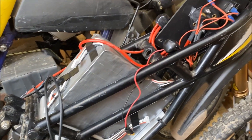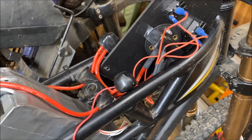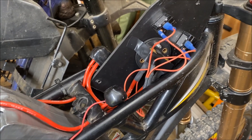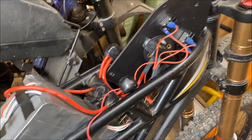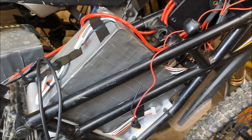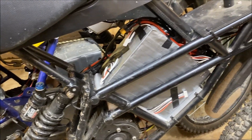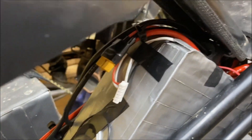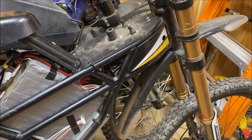While installing this battery pack, I'm adding my control panel — a pre-charge resistor and a large marine switch to turn it on and off. It was a little more detailed to wire in since the whole positive has to run through it. Now I just got to hook the negative up and the charge port, and we are good to go. The battery is back in, the whole bike back together, negative port taped up nicely, everything situated, and all wires zip-tied.